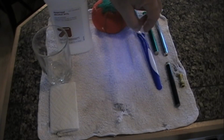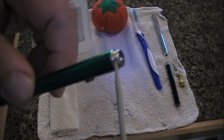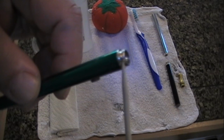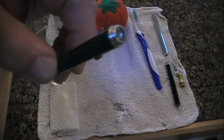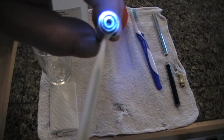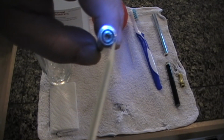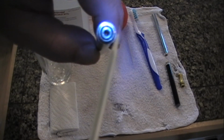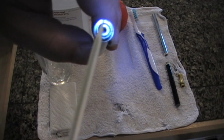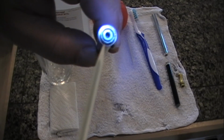A quick visual inspection of the battery connector itself will often reveal a black residue in the battery threads. Upon closer inspection with the flashlight, you may also note that the outer ring of the post has a black residue in it. If you cannot see the metal upon inspecting it with a flashlight, this is a battery that is definitely in need of cleaning.